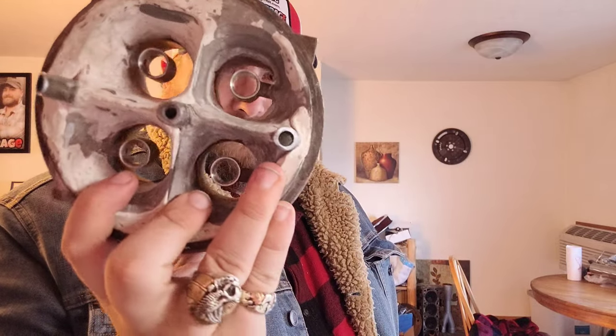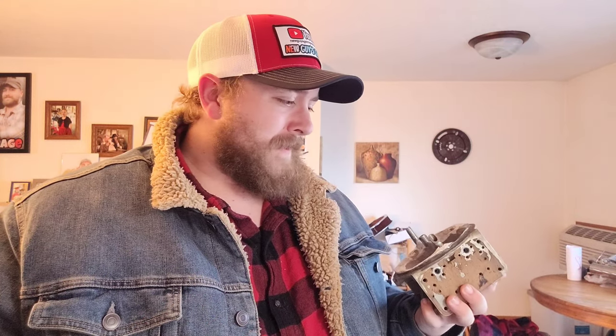Ultimately we might be trading off booster signal efficiency for CFM. I'm going to do everything in my power to maintain booster signal because that's a key part of this whole process, but we also want the additional CFM. Joseph Nowak, when he's flow testing this carburetor, is actually testing for booster signal as well — he mentioned in his video that booster signal went up with the step one modifications, so I believe he's tracking it and we'll be able to see the results.